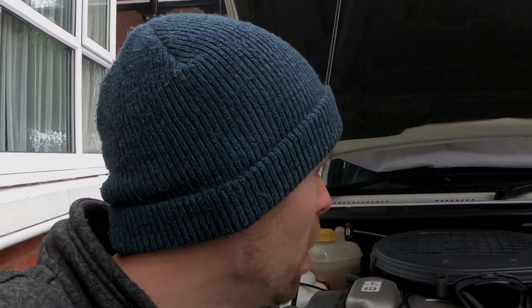So before it was idling a bit lower, but the truth is it's absolutely fine. There's no hunting, there's no cutting or stalling. So whatever crappy fuel, I'm presuming it's crappy fuel, that's still going through that tank. The fuel that I had in the car when I bought the car for Rob, we think had been in the car for 12 months. Hence the sand in the carb.